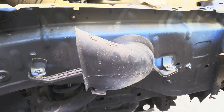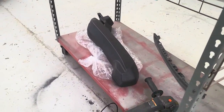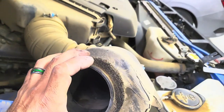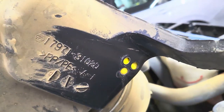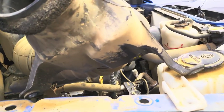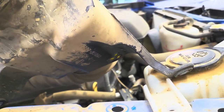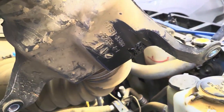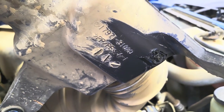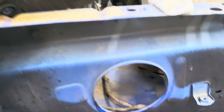I'm gonna remove this and test fit the bottom piece — it's not that bad. Underneath the intake piece that goes here, my Toyota has little holes in the bottom which I'm gonna seal up with some seam seal, bond glue, or plastic weld — just to prevent water intrusion. As far as my intake goes, I sealed it up with heavy body seam seal. First you want to clean it with some lacquer thinner, make sure it's really clean inside and out, then put some tape to keep it in place while it hardens, and then put it back in.